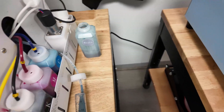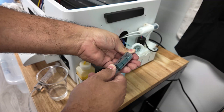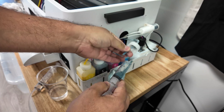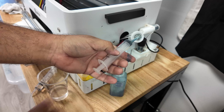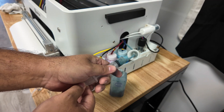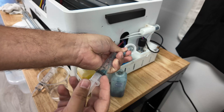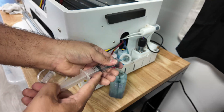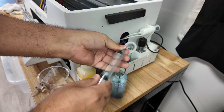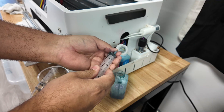I'm going to put the camera down for a second — now I have my two hands. So once I do this, your waste ink — just pull this back out. Then pour everything here, put this back on, and slowly — you don't need to rush this — just start pulling the fluid again from the pad. Take it out, put it in here, and rinse and repeat. You want to try to take everything out of that pad. The pump will do it for you after, but that's the process I'm going through right now.